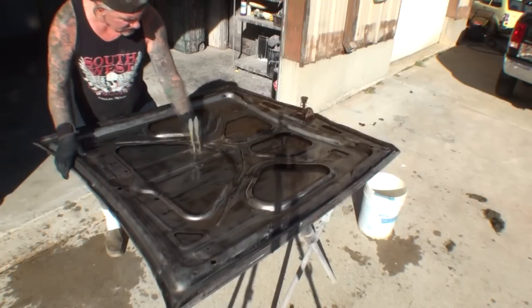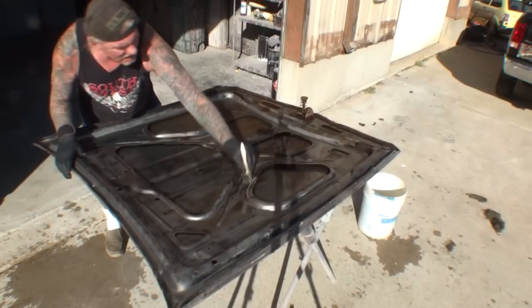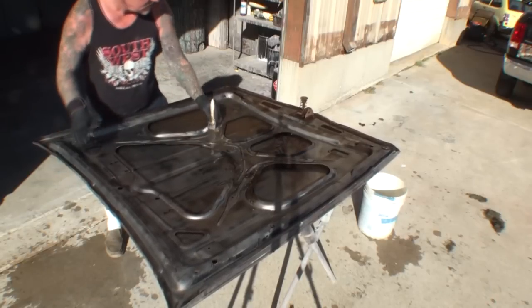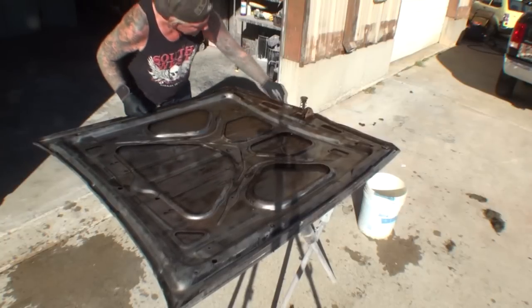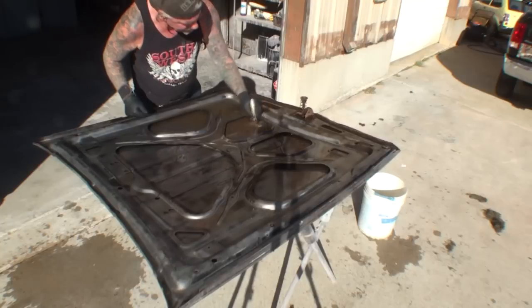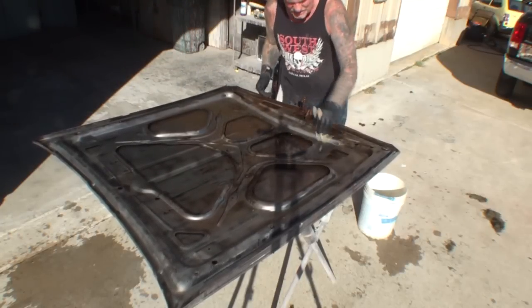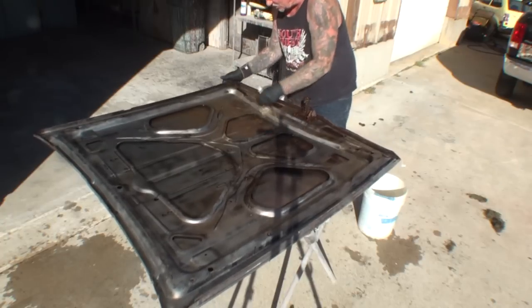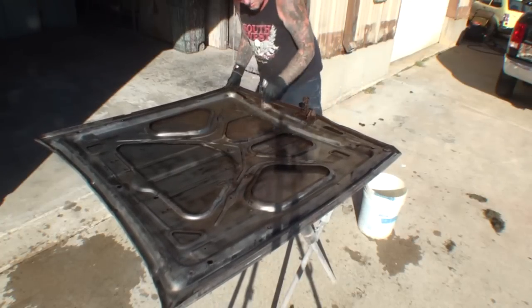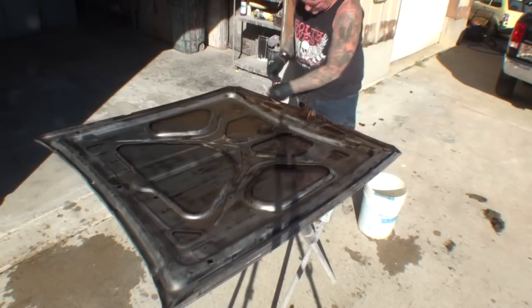So I'm going to continue to use my throwaway brush, and this is to get inside everywhere and also put the vinegar on top of that surface rust that we're talking about, especially right in here. And we'll go ahead and get our latch while we're at it. But once again, this is how you remove the soda from the piece of metal that you just had soda blasted.